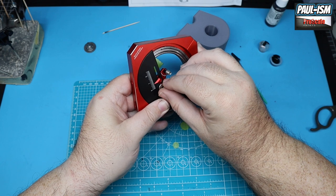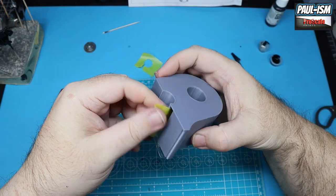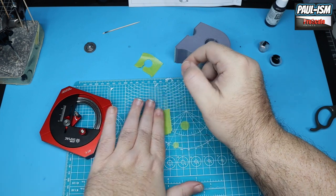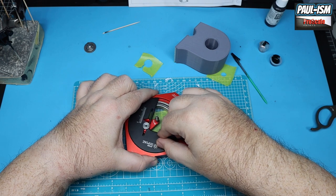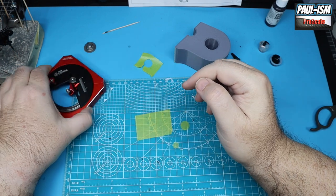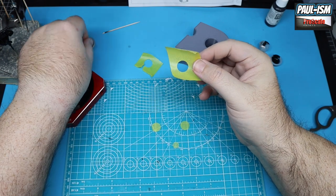We've got the space circle cutter now. What we're going to do is make our circle template the right size. You can see I've already test fitted a few that weren't correct. And we're going to mask off the central hub on the brake disc and spray it black. So the space circle cutter is an expensive luxury, I'm not going to lie. And yeah, don't let your little blade fall out. That's really annoying. But it's a very good circle cutter.